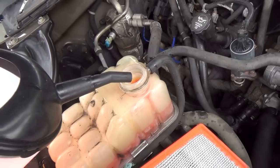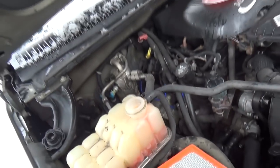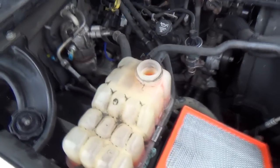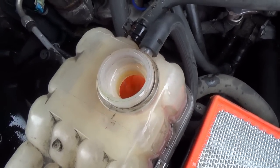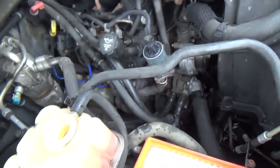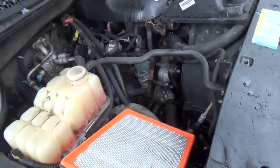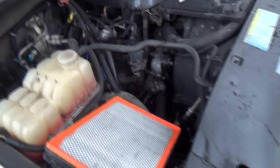Now the heater core hasn't filled yet, of course, because it shouldn't have technically, no. But what we've got to do is, after it sits here and gurgles for a little bit, we'll have to fire it up. Ooh, there's some nice gurgling. Sometimes you can shake her a bit too and it'll dislodge bubbles, but we'll let her sit for a bit. I'll keep topping her up, and actually we could probably put all this crap back together now.